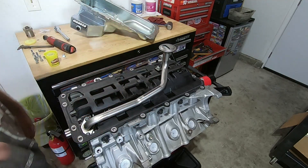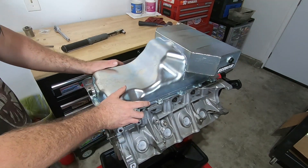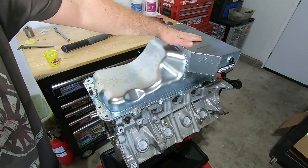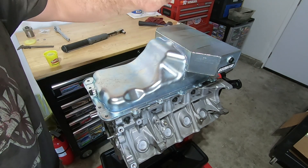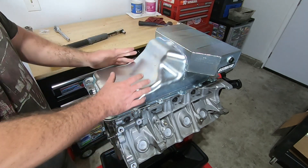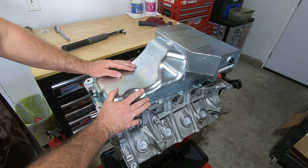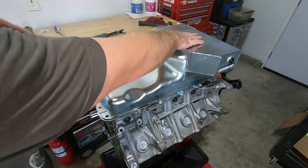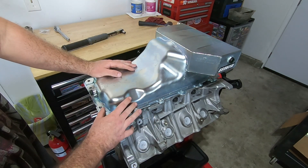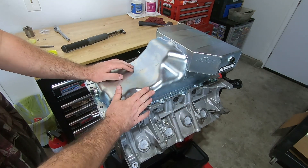Now the oiling system is done. One place you really want to watch out for is this area of your oil pan — I've seen cars come in where they've bottomed out and hit the bottom of the oil pan, which pushes it right up into the pickup tube, starves the engine of oil, and burns it up — usually spins a bearing. So keep an eye on this area of your oil pan. The last thing I need to do is put the rear seal on, but I'll put that on once it comes off to get loaded up in the truck. Thanks for watching!